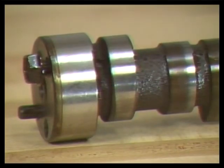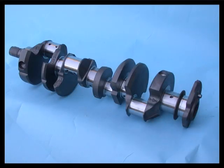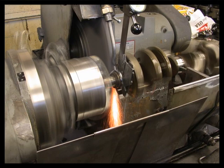If the engine is low mileage, you may be able to reuse many of the major engine parts: cam, lifters, crankshaft. Measure camshaft wear to see if the cam can be reinstalled in the rebuilt engine. Also, inspect and measure the crankshaft. If you find major wear or damage, there's no need to take the time to mic the journals. Simply send the crank out to be machined.